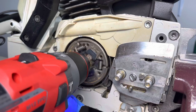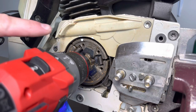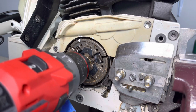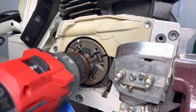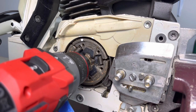What's been happening is it's been sparking there. You can see I've put a couple of dots there - the first one was where I thought it was, and the second one is where it ended up being. Now, if I was to put the engine at wide open throttle, it would probably be advanced - sparking before. That's because the flame front takes time to propagate throughout the cylinder. If we spark at a certain time, it's going to be after that time that the fuel is fully ignited. So the faster the engine is running, the more advanced timing we need.